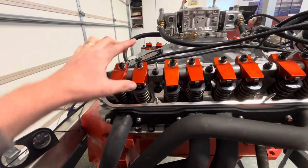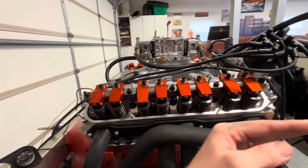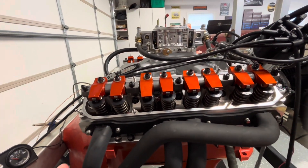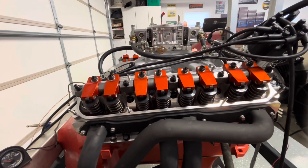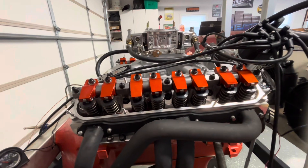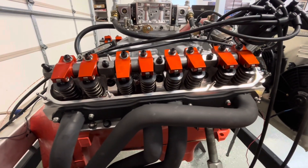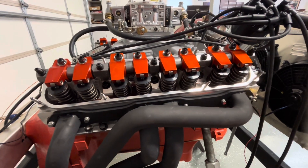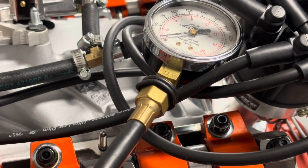So let's investigate. I went ahead and relashed that one, and before I pull that shaft off — which I technically don't have to, but I'd like to investigate a little closer — I'm going to do a compression check on all of these. The rings may not be totally seated yet, but it should clearly tell me if there's one that's far below the others. The odd side looked really good, so let's see what this side does.